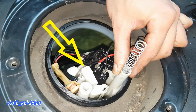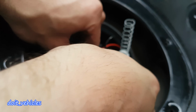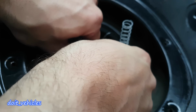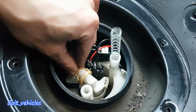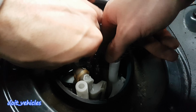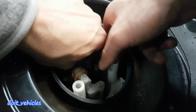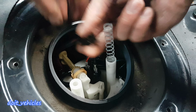on the fuel lines. If the fuel pressure is still low, you might want to check for voltage drop on the fuel pump wires, or apply 12 volts and see if the pressure is within specs with an outside power source, and so on. There are a bunch of tests you can do to confirm if the fuel pump is bad or not. It really depends on what values you read on your car.